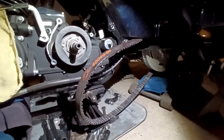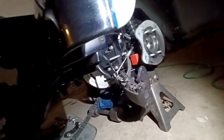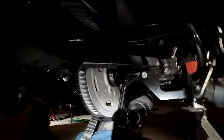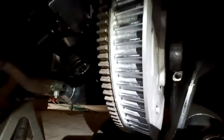That's pretty much it. It's definitely a lot of work. I wasn't able to use too many power tools inside with these clearances. Maybe with a more compact electric impact or a better air gun I could have removed most of this stuff, but most of it had to be done by hand with wrenches due to clearance — very laborious, very tiring, very time consuming. The front sprocket looks good. The rear sprocket does have a little bit of nicking, as you can see there.